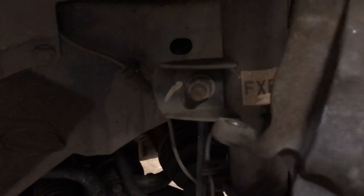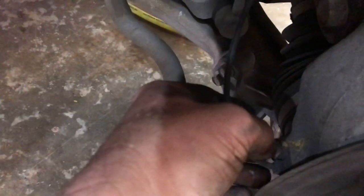I'm getting ready to take apart this bolt right here — this is the upper sway bar link bolt. This is a very important step and will be a lifesaver. Make sure you take that nut off and pop the sway bar down and lay it out of the way. We're also going to take a 10 millimeter and pull our ABS wire out of the knuckle. That sway bar bolt especially is going to make this job so much easier, believe me.